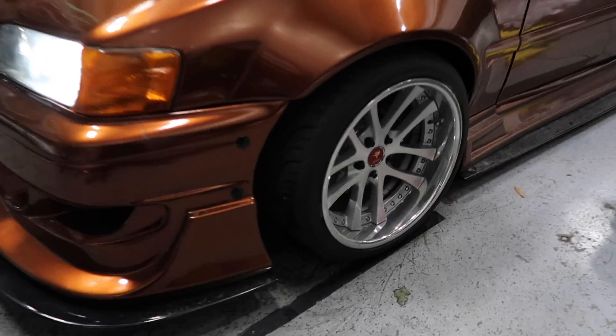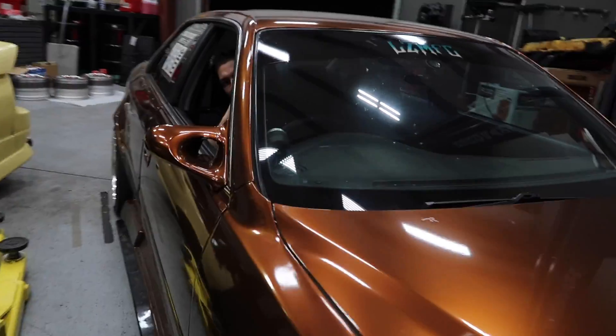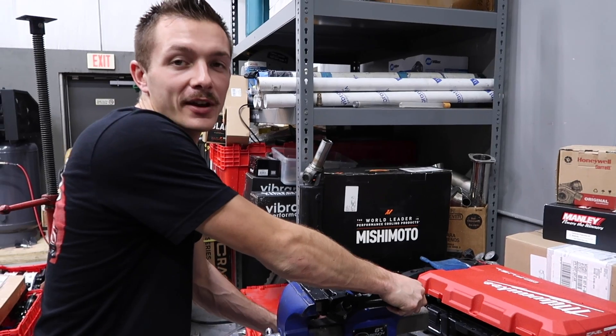We've got a problem — in these cars they have a really big issue where the stock tension rod bushings go bad and the car gets a lot of movement under braking. Those came off my other chaser and I thought they were good. I stole one from my other chaser because it has the upgraded JZX110 pillow ball ones. I think I'm going to steal the pillow ball ones off that car and put them on this one. The pillow balls will be nice since we have a lot of play — that's probably why the car is acting weird, because it's basically having active caster while you're drifting.